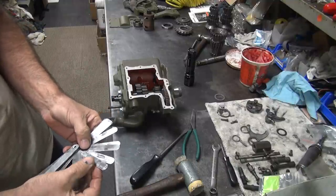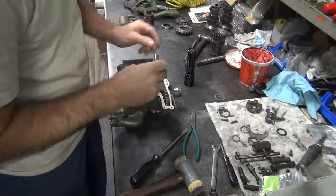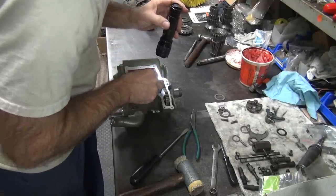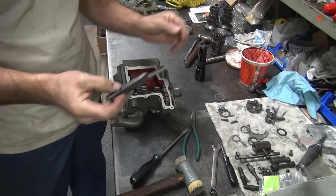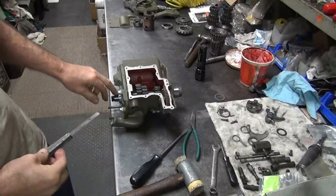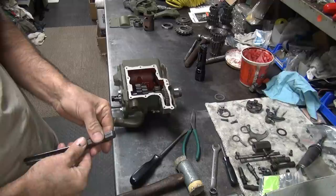So that's before we tighten the gasket way down. And also before getting more extra wear, so it kind of goes hand in hand. And so 11, 10 goes in there nicely. Just nice little drag on it. So we got 10 thou there. We had a 9, a tight 9, so it's 8.5. So they're almost equal.